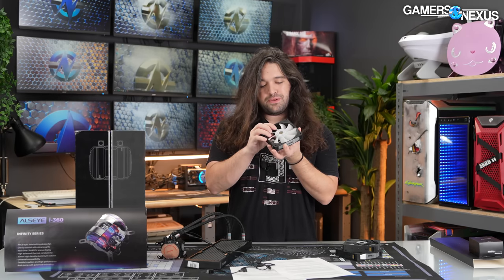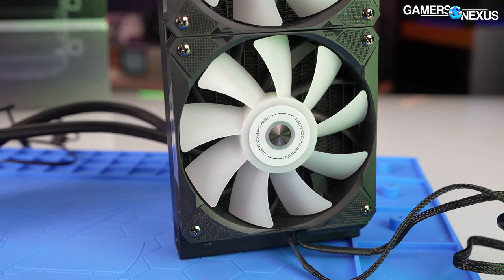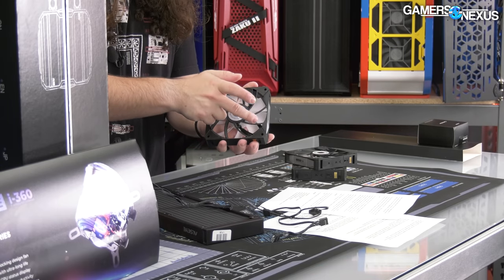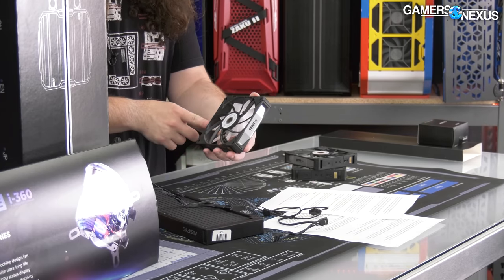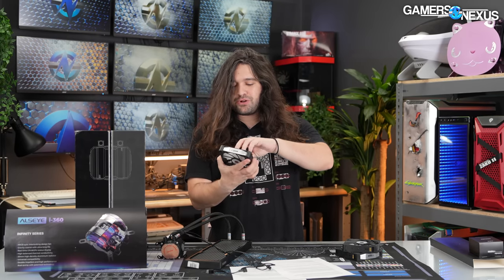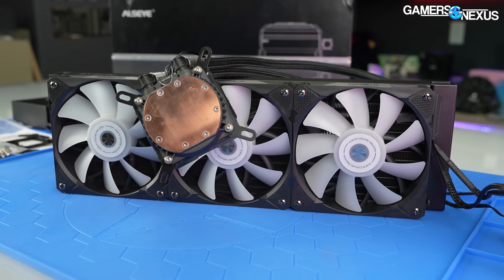The fans have metal branding embedded within the plastic — they aren't themselves metal, but it still makes for a better look. That wasn't the only weird thing we noticed about the fans, though — there's a gimmicky thick sticker that tries to make it appear like an exposed metal bearing and hub. The other thing was the nine-strut design: the back of the fan has nine support structures instead of the typical four, and it's also a nine-blade fan. This is probably going to cause some problems for acoustics, as blades passing over those struts generate excess noise, especially at lower speeds.